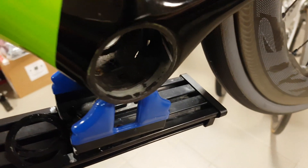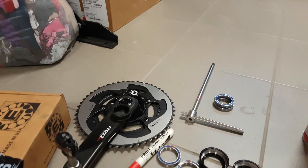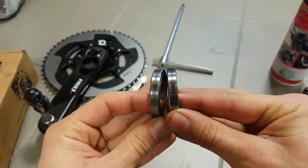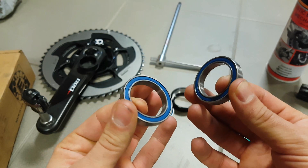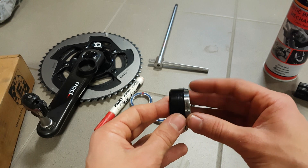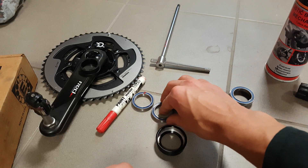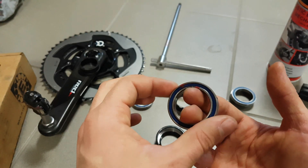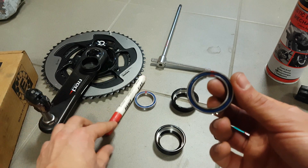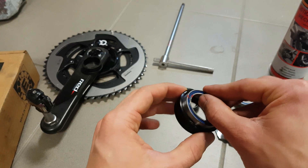What I did was I heated up the cups, same as when removing, and then with one of my press-fit drifts I hammered them in. These are the old bearings which came from FSA, as on many standard bike bottom brackets, and the bearings were getting a bit tired. This was mainly because of the very narrow stance width on these asymmetric bottom brackets. The fit is quite tight between the cups and the bearings, much tighter than between the cups and the frames. I need to stress this: in order to successfully install them this way, you have to first put the bearings in the cups before pressing them into the frame. Heating up is a very good option because then it will be much easier. You can note that I also marked the outside of the bearings for easier placing, and this way, if the balls are facing outwards, they're much easier to service.